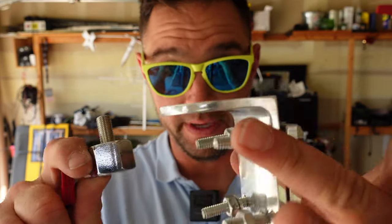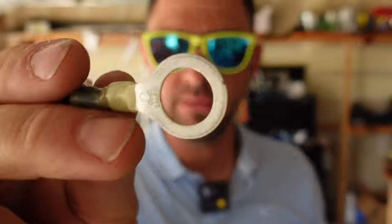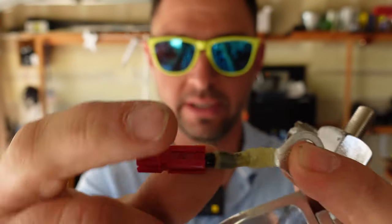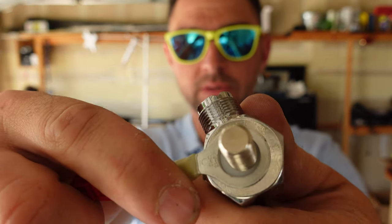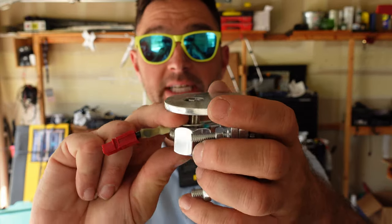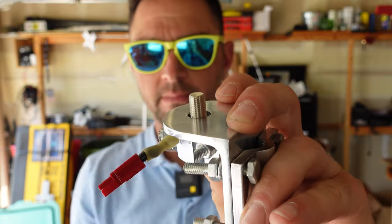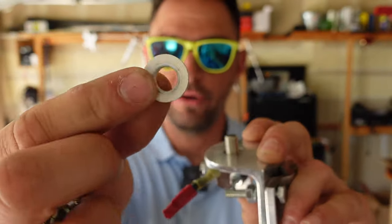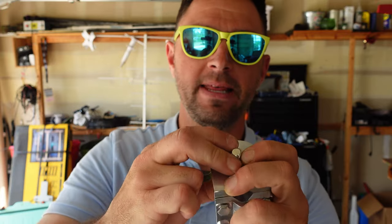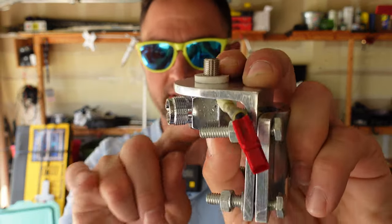Here's what we're going to do: take apart the trucker mount. I like to get one of these ring connectors, attach a small short piece of wire to it, then use a PowerPole connector - a cheap knockoff PowerPole connector typically works best. I'm going to place that ring connector so it's only touching the outer portion of the connector, which will be our outer shield or radial wire spot. Then I'll place it through the trucker mount. We have a little piece of plastic ring as an insulator, and I'm going to pop that in there, separating the antenna from the rest of the device.